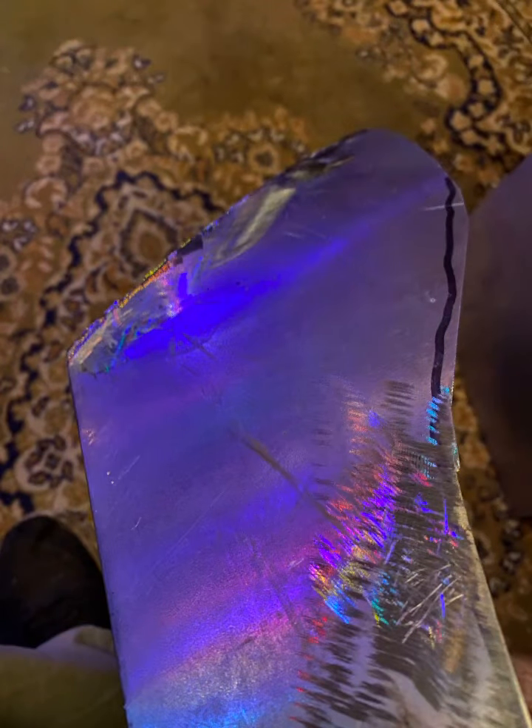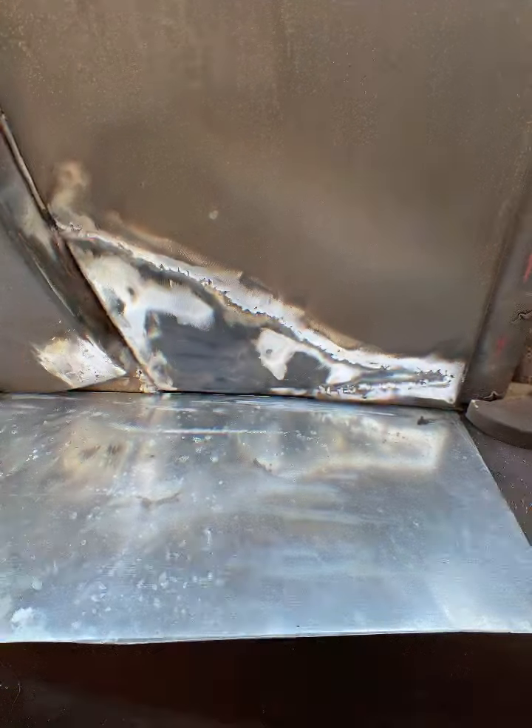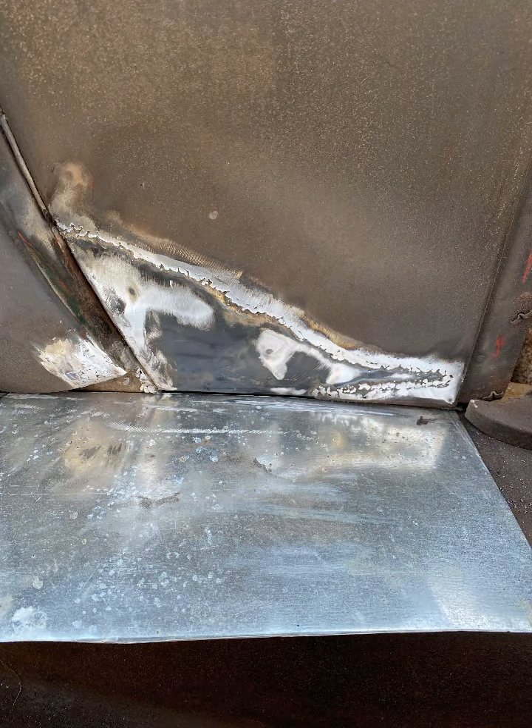This odd bugger — this is our patch panel — it's going down in there from the inside. I welded it up instead of trying to bang that into shape. I feel it'll be a lot more rigid, and I doubled that steel up on the flange because it gets bolted up to the body literally. I put a rust stop on it first, so it's up and behind the panel, and I have little spot welds from the inside to hold it first.